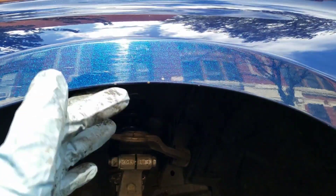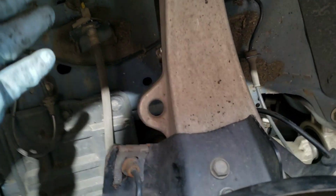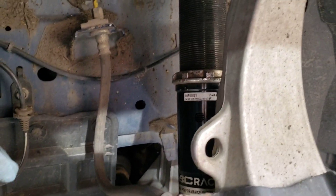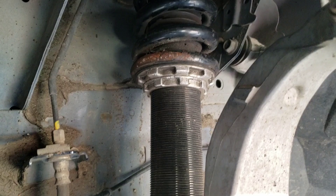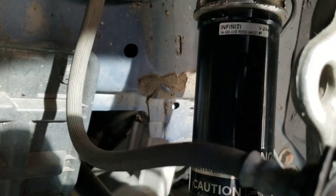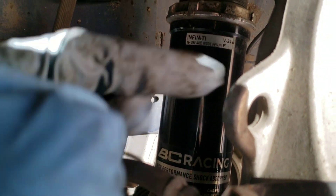I'm going to need to bring down the front end about two inches off the coilover shock. You can do this one of two ways. The slightly harder way: you loosen this collar — counterclockwise — and then by hand twist it down. The other way: loosen this collar, but also take out this bolt — remember it's a 14mm bolt down here. This will allow you to move the collar all the way up and just twist the bottom collar up.